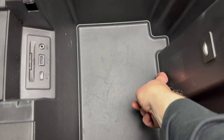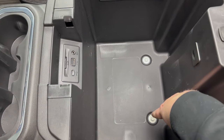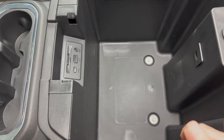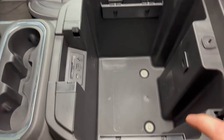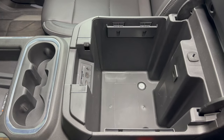Then if we take a look in the bottom, we see this little tab right here. If you get your hand on that and pull up on that liner, it's going to expose these two bolts. These are going to be the two 10 millimeter bolts that we need to remove. So I'm going to go ahead and remove those two bolts, and remove those four screws and take those two brackets off, and then I'll check back in in the next shot.